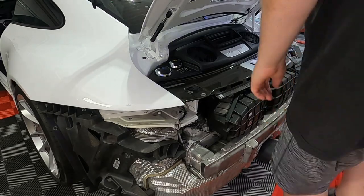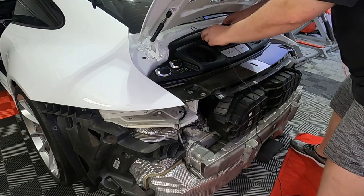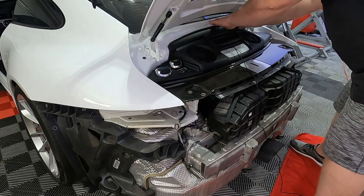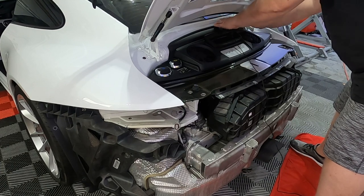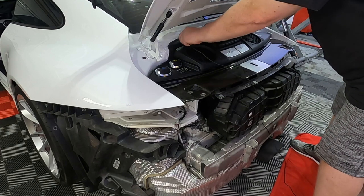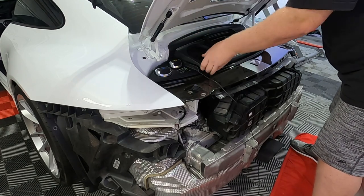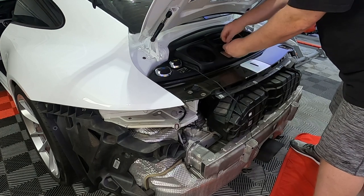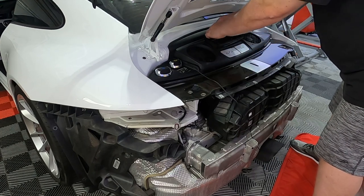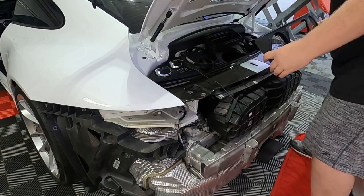All right, back outside of the car, I'm gonna run the terminating end of the cable just around the trim, which is on the upper edge of the deck lid, around the heat shielding. I'm gonna run that cable around where the driver's side light is. Now, in order to do this, I am gonna start taking apart the trim a little bit like you might do if you were doing an oil change, just so that you can get the wire snugly in and around the trim.